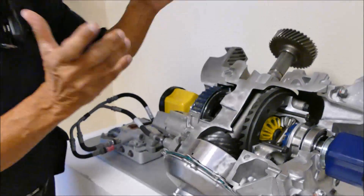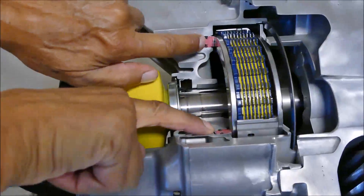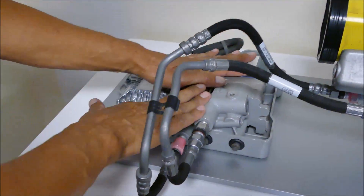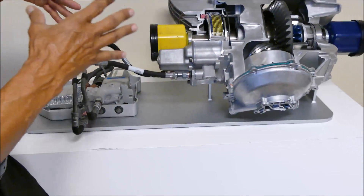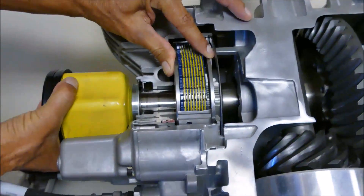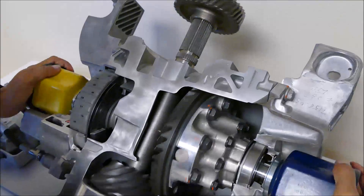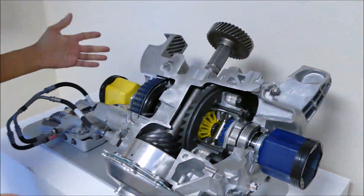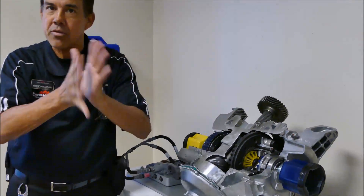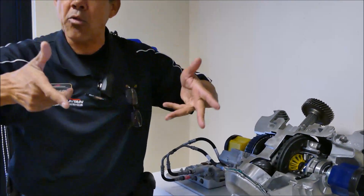Once we begin to accelerate and take steering out, these little pistons — there are about five or six of them in here — are operated by this computer and this pump. The computer tells the pump to activate and it clamps these clutch plates together, allowing both axles to drive completely, giving us basically a locked rear end. In a nutshell: you come off the throttle, it opens the clutch plates up with no friction; you apply the throttle, the hydraulic pump clamps them shut so we're driving both axles.